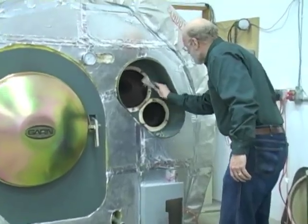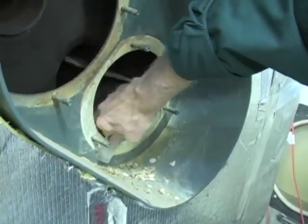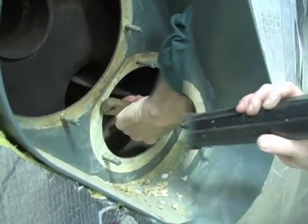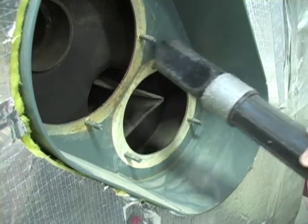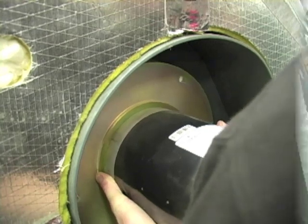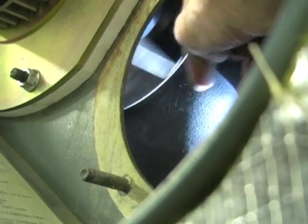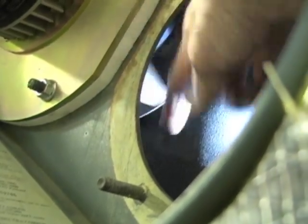After you've cleaned the heat exchanger tubing it's time to replace the blower motor assembly and upper clean-out. Always wear a dust mask and safety glasses for this procedure. Reassemble them as you were shown in the lower clean-outs. Scrape and clean the unit surface and back of the clean-out plates to remove all gasket material adhered to the surface, then put anti-seize compound on each of the bolts. Hold the assembly securely and carefully slide it onto the bolts. Put a nut on the top bolt to stabilize the blower motor assembly, then tighten the nuts lightly criss-crossing across the plate so the assembly seats well before tightening. Spin the blower wheel from inside the blower housing to make sure it isn't hitting or scraping anywhere. Adjust as needed, then put on the upper clean-out gasket and connect the power and sensor to the controller and you're done.